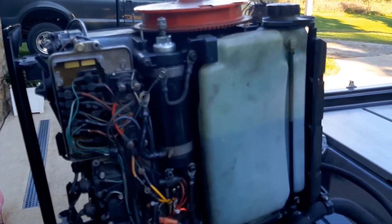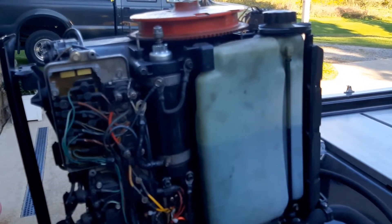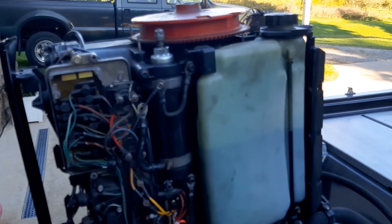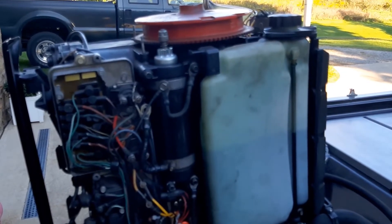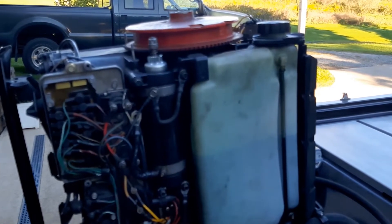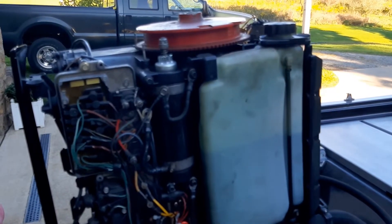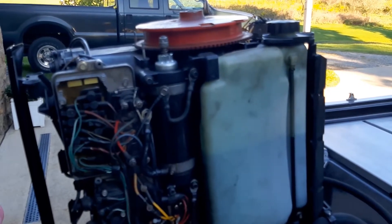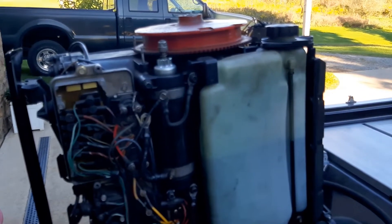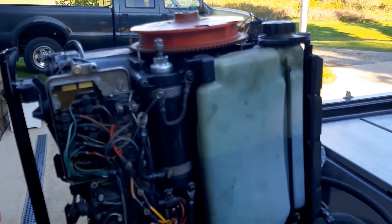What it's doing is the voltage at the battery is fluctuating a lot — it goes from around 12, maybe dips below 12, and goes clear up to 18. It just constantly fluctuates. So it is charging, but clearly the regulator is not working. On engines from this era and into the 90s and 2000s, you had a combined regulator-rectifier. I'm not sure if that's the case here, but that's what was confusing me because the manual doesn't really recognize that type of system.